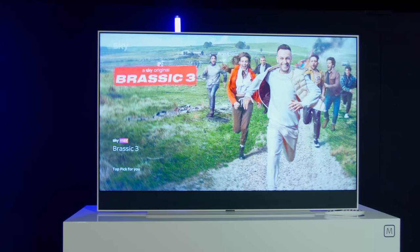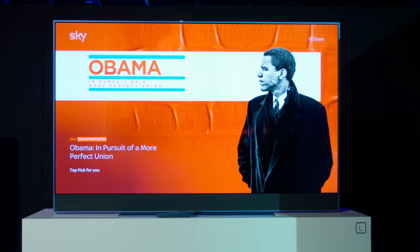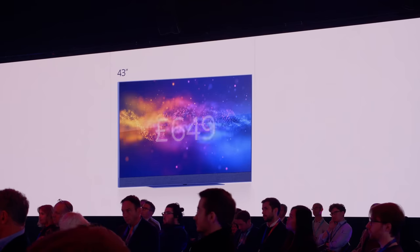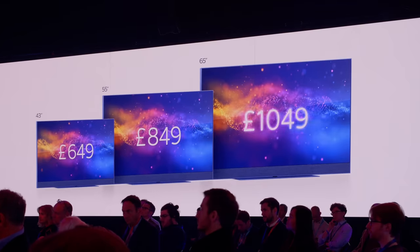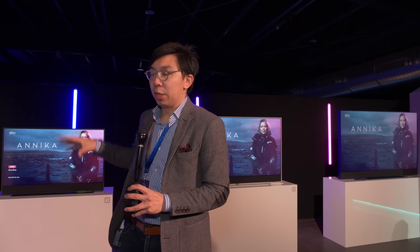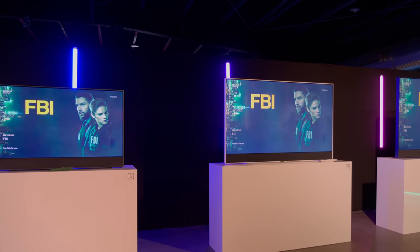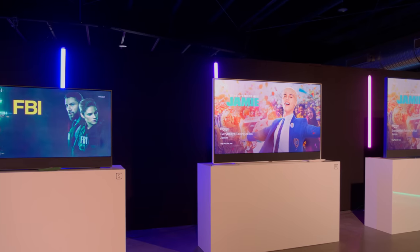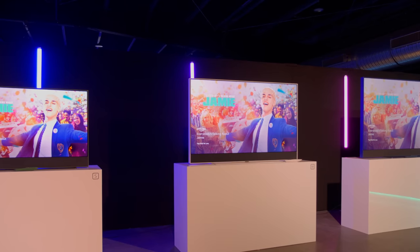And the middle one would be the 55-inch version, and the far right one, relative to you, would be the 65-inch model. And according to Sky, these are the three most popular screen sizes in the UK and the rest of Europe, and who am I to argue with them? So from that point of view, these TVs will be equipped with a VA type LCD panel. The viewing angle does degrade and the blacks turn slightly grayish, off axis, but straight on, the picture quality is respectable.